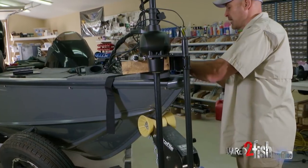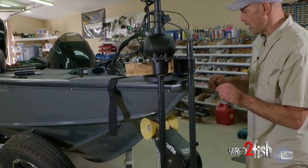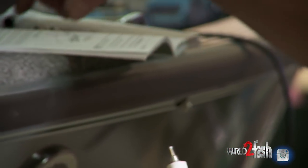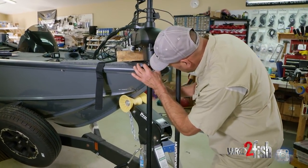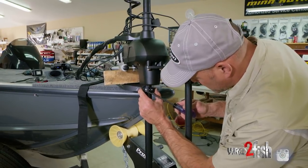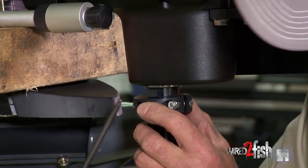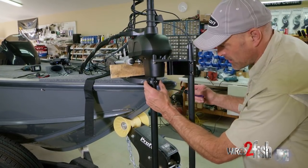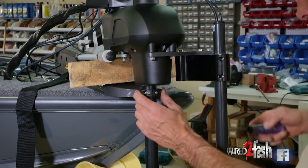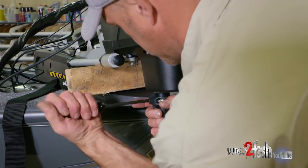The kit comes with a little tube of anti-seize — we're just going to put a couple of drops on each bolt so we don't want those to seize up. Now that we have everything started, the rubber bumper in place, and both halves of the collar assembled, you'll notice one side of the bolt is slotted to receive the nut and the other side is smooth — and on the opposite side it's reversed — so one side is smooth and the other receives the nut to keep it from spinning as you tighten it. Hand tighten only; don't use an impact or any power drill.